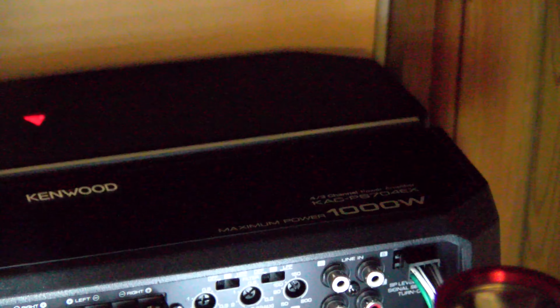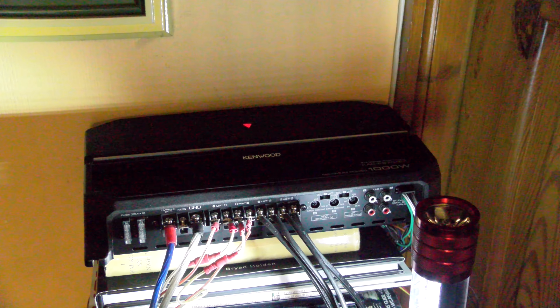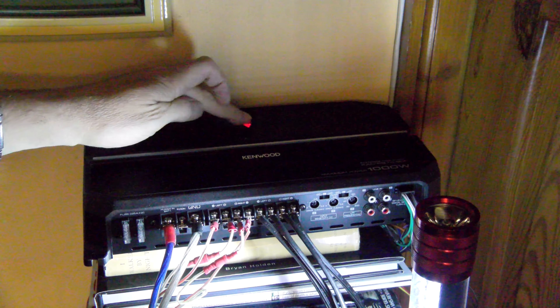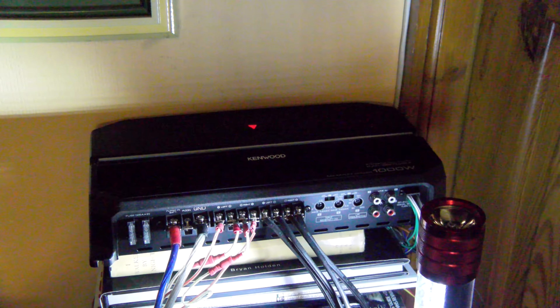The printing on the top might be a little bit cheeky for saying 1000 watts, but that means 250 watts total peak from each of the 70-watt four channels. But this amplifier is just so, so underpriced — it's ridiculous. Lovely cast chassis, 50 amperes of fuses, the little LED lights up the moment you power up the head unit — it's a tremendous piece of kit. For all it seeming rather inexpensive, it's definitely not a budget item. It's scored a nine for sound quality, which is absurd for a product at that price — and it's selling for £150. Go figure. Kenwood are going to kick some sales out from under the feet of the American vendors with this one.